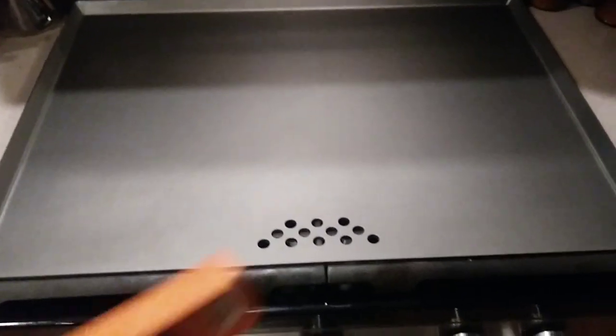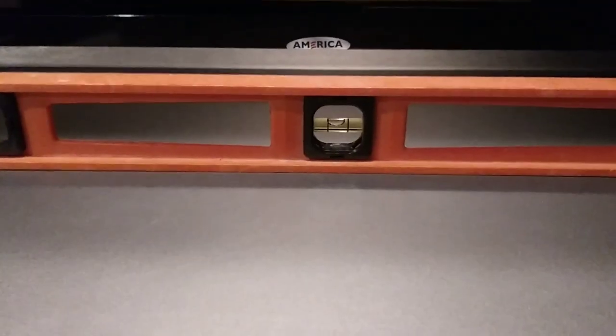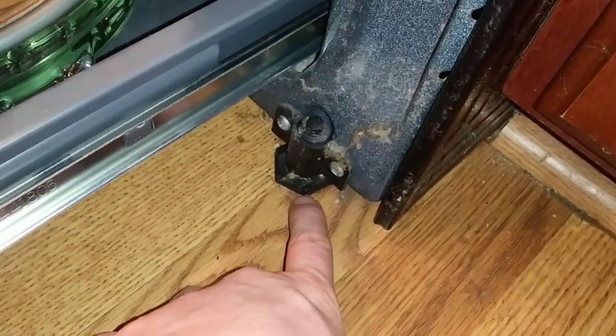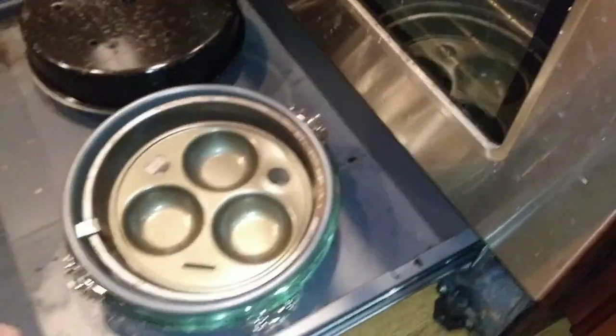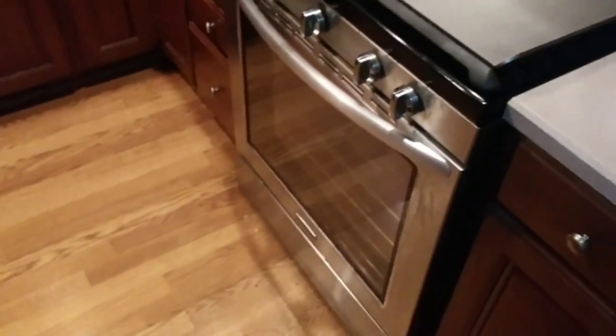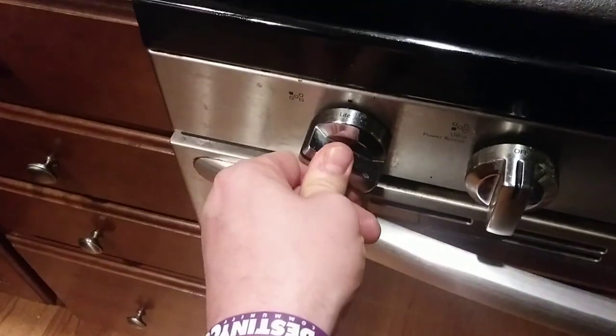I went ahead and put a level on this. The flattop's cool right now, but I'm just a little off-level on the side, and my back to front is pretty off-level. So I actually need to maybe level out my stove, which can be done right down here. You can level out your left and right, and then if you remove the drawer completely, way back in there, there'll be a couple other pegs where you can bring up the rear. That might be something you want to do if your stove isn't level, so you don't have things rolling around. Now that everything's nice and level, we're going to heat up the flattop.